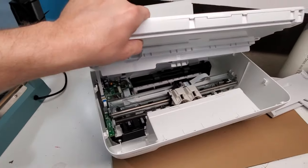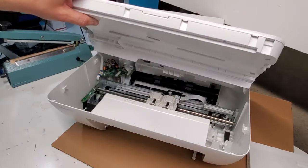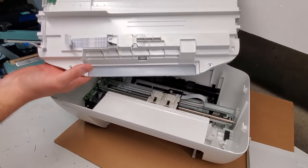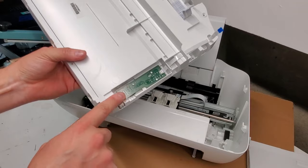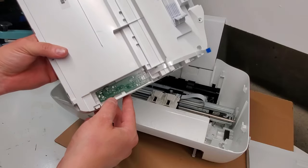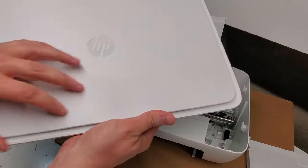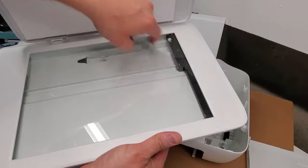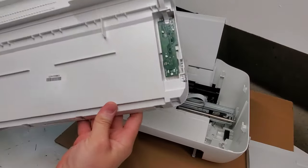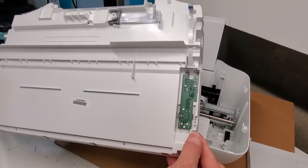If you want to remove this part to get to the inside of the printer, you can just disconnect it. On the bottom side we have the control panel board — it's going to need a smaller star-shaped tip, not T10, to remove or replace it. To get inside to replace the scanner lamp, it's this unit here, or if you just want to check what's wrong if it's not moving or if there's no light coming on.